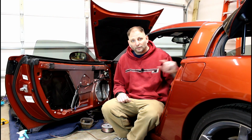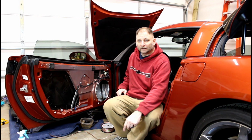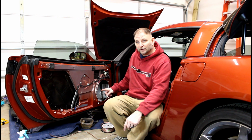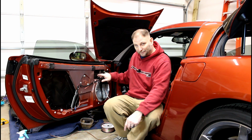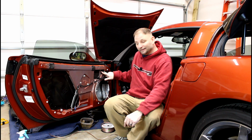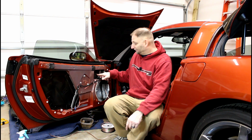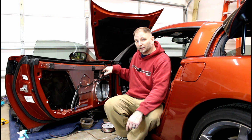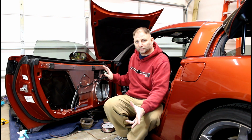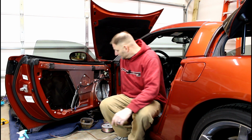All right, we got our speaker wire run to approximately where the amp's going to go, plus about a foot. Mounting 6.5-inch component speakers. So I have a 6.5-inch speaker here and then a tweeter. I think I'm going to put the crossover here. Not exactly sure yet. Behind this piece of tape is a hole. That wire can come out, feed in that crossover, go right, the wire for the mid bass and the tweeter, go right back through it. That's why this looks like a good plan. I just need to make sure that works out.